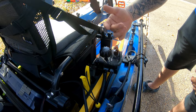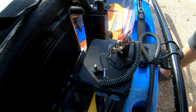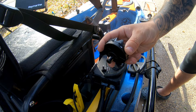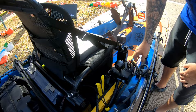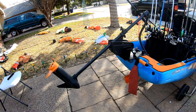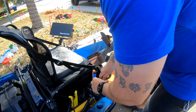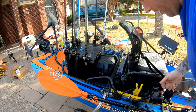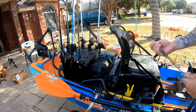I've got a conduit box from Home Depot — I took the whole head off the motor where all the solenoid wiring is. This knob I purchased on eBay was hard to find; I tried oven knobs but they don't fit the half-moon shaft. I found this one on eBay — it's for larger boat motors and has speed markings, though those speeds don't correlate with my motor. It's plugged in and off right now — speeds one through five forward, then reverse one through three. I also have a kill switch clipped to my jacket: if I fall off, the kill switch pulls out and the motor shuts off completely. Put it back in and you're ready to go.